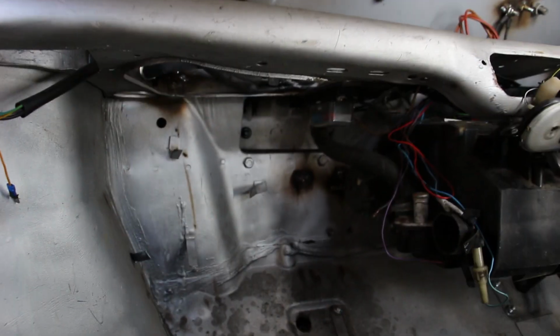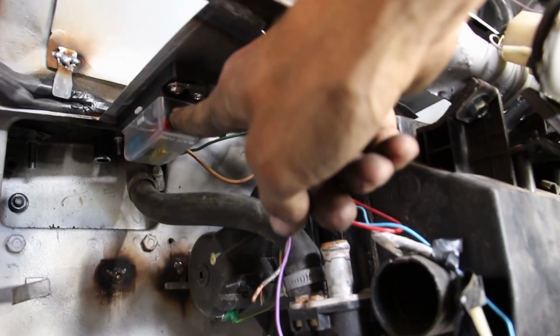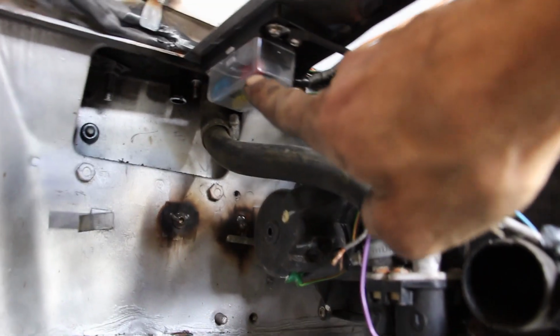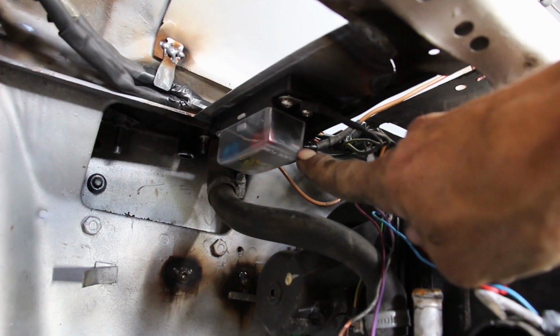Horn, interior light and hazards. Those three will be permanent live fused, and then this is basically going to be a power, which is here. This is going to go into the forward circuit, and when the ignition one comes on, this circuit fires up, and we've got three fuses in at the moment, multicoloured because it looks pretty. Don't know if it's functional, and one left to connect, and that will be for the stereo.